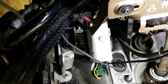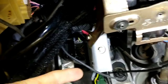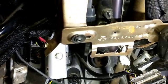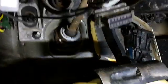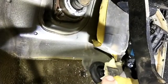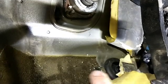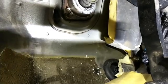I've got the ECU pretty tucked up in there — it's going to be up high, clear up right next to the park brake mound. That gives me a pretty secure place to put it and then the wiring is just going to come down. There's enough stuff in this Dakota I wasn't able to get up high anywhere, and it's got a big enough brake booster that didn't give me any access around there.